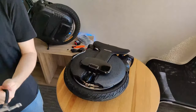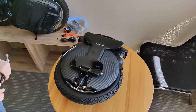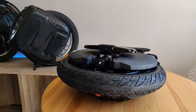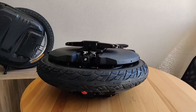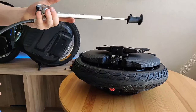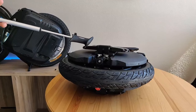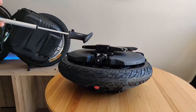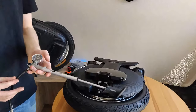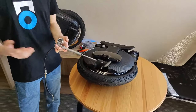Is the wheel hub aluminum? Yes — pretty much all electric unicycles right now use aluminum for the rim and motor construction. The suspension looks to be all aluminum too, which is cool to see. Regarding the PSI range for the suspension: the pump they include goes all the way up to 300 PSI. Based on research into mountain bike front fork suspension — the closest analog — I haven't seen anything over 200 PSI in terms of ratings. Once we can pump up the suspension and test it, we plan to release a suspension guide by rider weight for the V11.